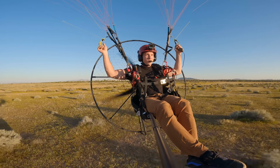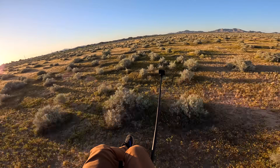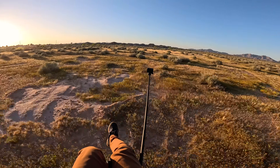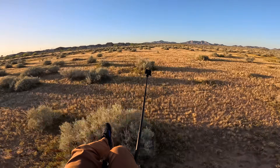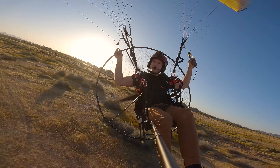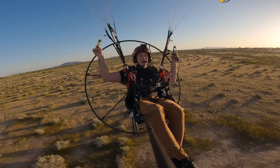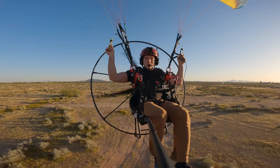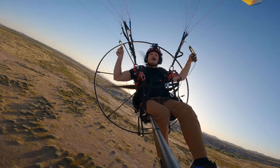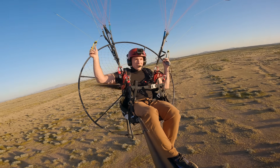Flying this and then going back to a normal two-stroke feels a little antiquated, like you're back on a horse and carriage. The frame itself is very comfortable — the harness is comfortable, intuitive, and easy. The weight shift is good, though it's not as weight-shifty as the Maverick; it feels a little more locked in. The torque compensation is not the best — it could use more, and you notice that when you accidentally goose the throttle hard. On a full throttle climb, if I don't touch the brakes, it wants to literally fly me sideways.